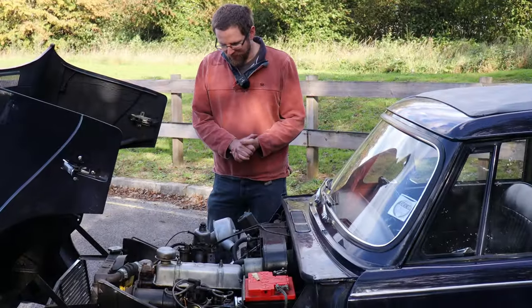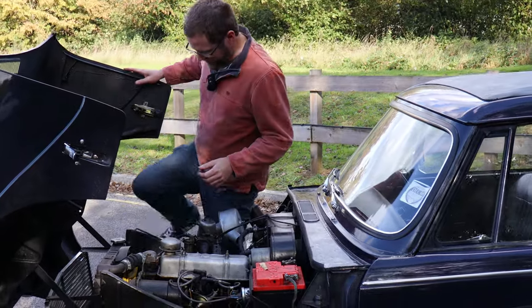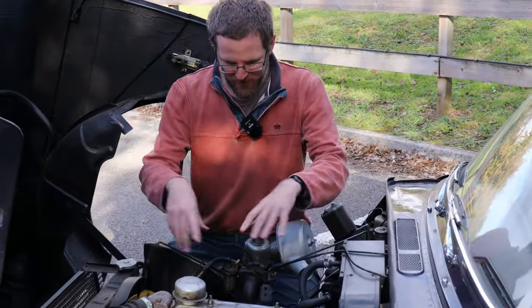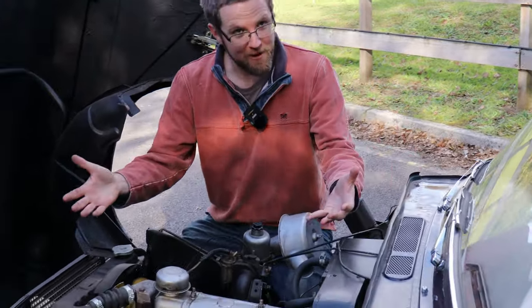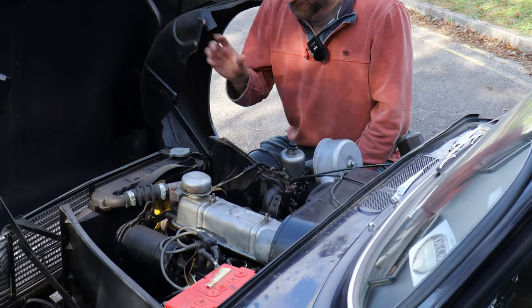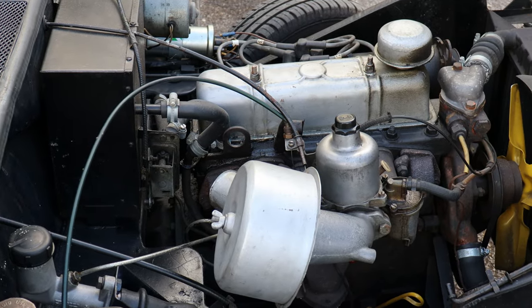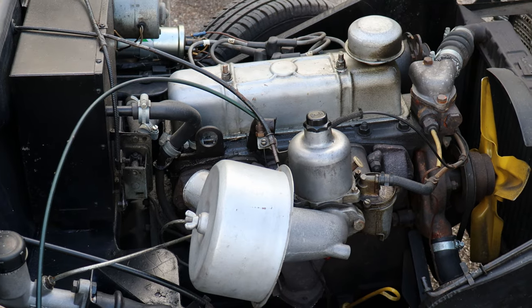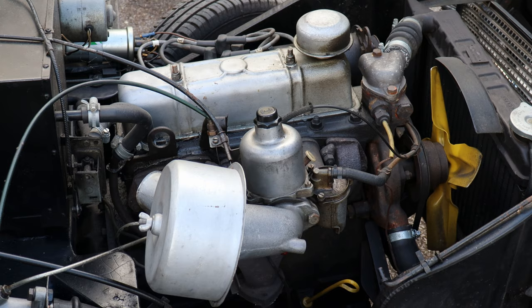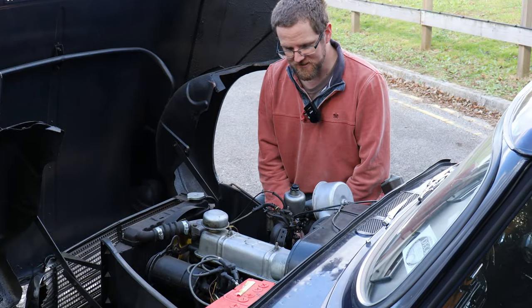The Herald's four-cylinder OHV engine is very simple, reliable, and conventional. One of the most DIY-friendly features is that you can use the wheels as a seat when doing maintenance — it comes with rubber-suspended seats. Make your usual checks: oil level, no oil leaks, no signs of head gasket failure such as emulsion in the radiator or under the oil filler cap, that the carburettor looks like it's had a rebuild within the last century, and that the oil pressure light doesn't flicker when hot at idle.